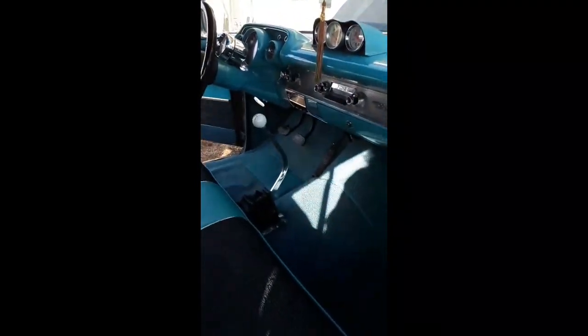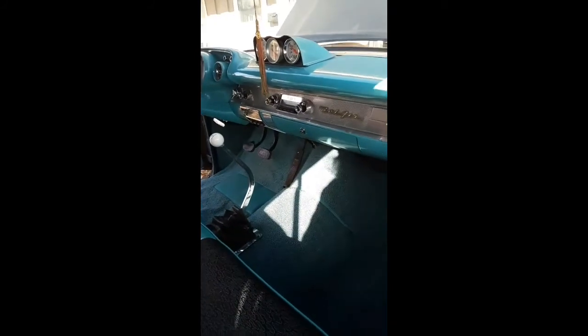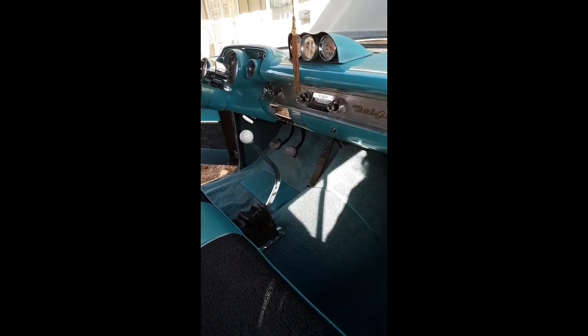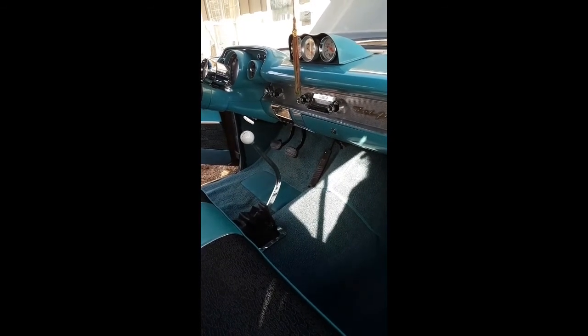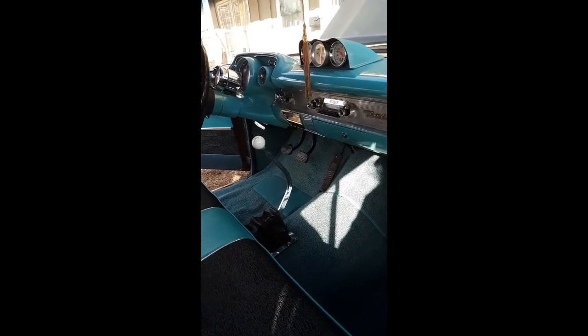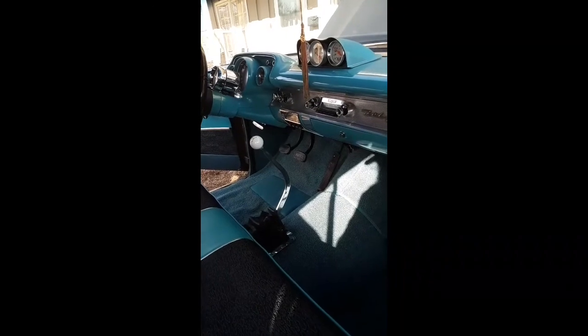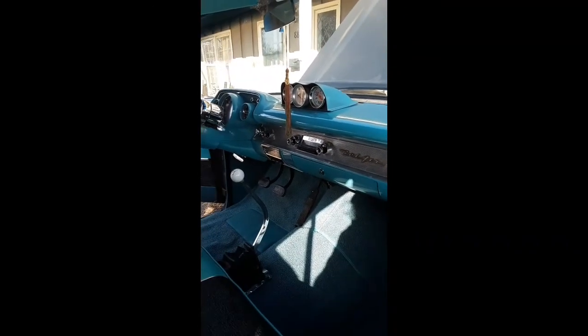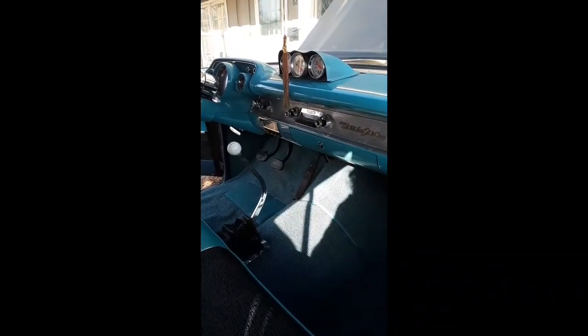It's got a 4-speed in it. I went through all of it. It's got all new shifter forks and sliders and the shifting dogs. I think I put a couple gears in it too. I think third and, I can't remember, maybe second were a little sharp, and just kind of set it up that way.